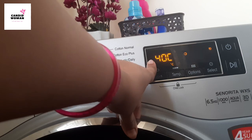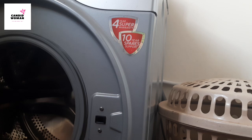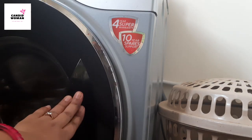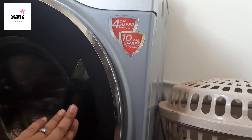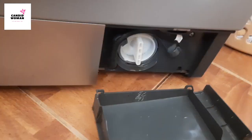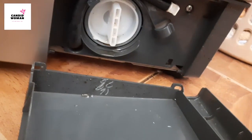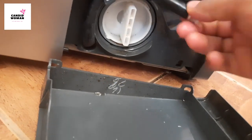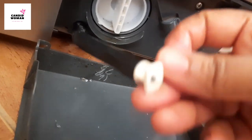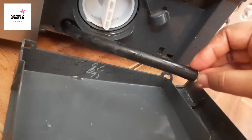This is the drum where you put your clothes for washing. Once you start the cycle, this door will not open until the water drains completely. Finally, this is the place where you can drain water manually — you need to use this when there is no power and you need some clothes urgently. There is a pipe and a nozzle on top of it; you pull it out and drain the water from here, and then you will be able to open the door.